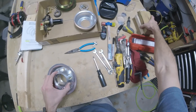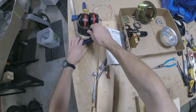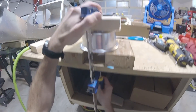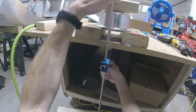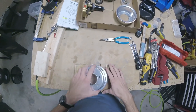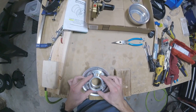We needed to take out the hub so we can get the valve stem through and have room. The best way to remove the hub is to press it out. I'm using two-by-four blocks and a clamp — you could whack it out, but using a clamp to slowly and evenly press it out is much better. Tighten the clamp and you can see it getting pressed out. Wiggle it out — there we go. Now we have the other wheel half and the hub, and since we made our mark we know exactly where to put it back in.